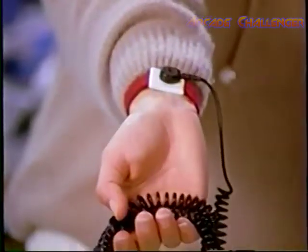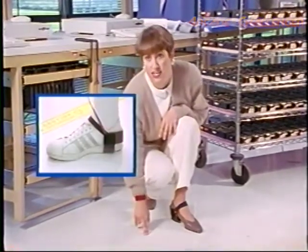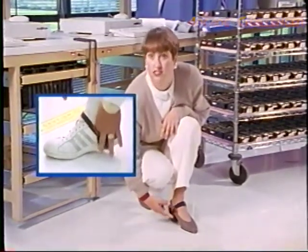The two pieces of equipment we wear are a wrist strap and cord and a foot strap. In order for the foot strap to be effective, two things must happen. First, make sure that the foot strap contacts the conductive flooring. Secondly, you have a tab on the side of your foot strap. Make sure that that is placed either inside your shoe or inside your sock.